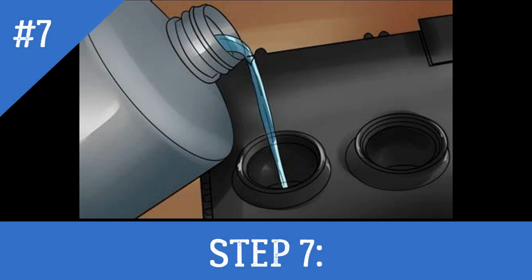Step 7: Fill each of the battery cells with sodium sulfate solution to a level just above the plates. Ensure the battery is level during filling. Place the battery in a well-ventilated area ready for charging and leave it to settle for at least 30 minutes. If the battery has side terminals, fit charging posts to the terminals.